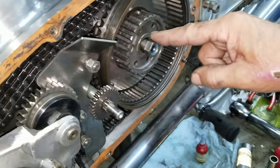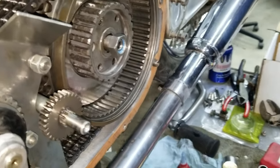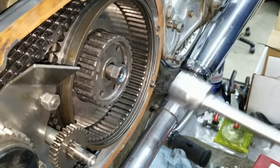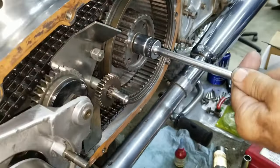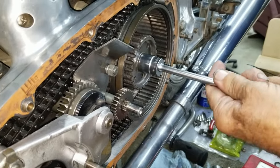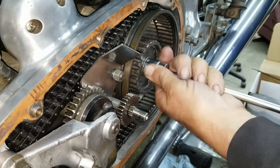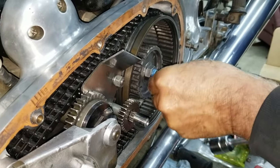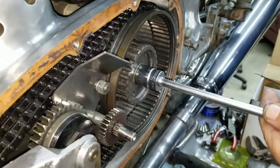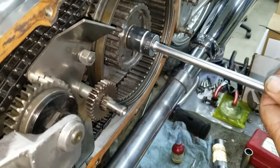In fact, this is supposed to be 45 foot-pounds. The book calls for 70, but that is way, way, way wrong. You will break that little clip we were showing you in there. Well, we can use some of it for the pushrod seal. Right. Okay, so I'm going to have to hold the brake. Ready? Yep. So 45 there, and he's holding the brake down.